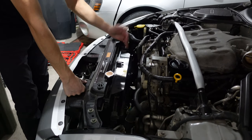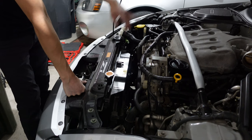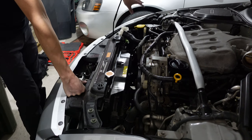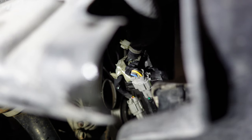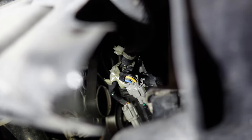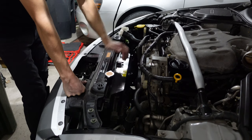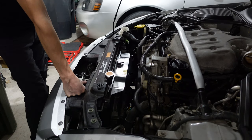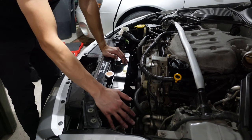Now everything's loose. You can also remove this radiator hose that leads from the radiator to the coolant overflow, along with the coolant overflow itself — it's just one 10mm bolt and it comes straight out. There is one more clip down here that I did forget about. It's pretty easy if you jack up your car, but if you can't jack it up it might be a little difficult to reach — make sure you undo that first before you pull the fan out. Now the fan should come straight out; just pull it up and make sure you avoid any of these hard lines over here so you don't bend or break anything.